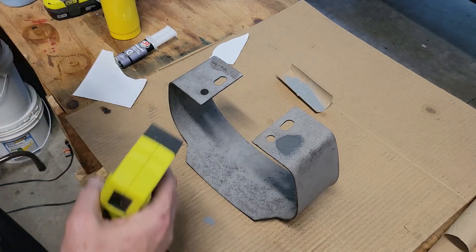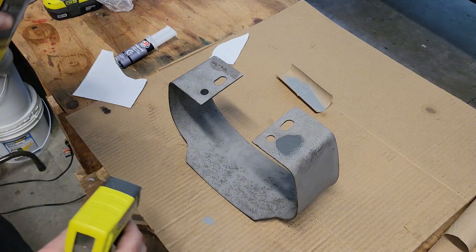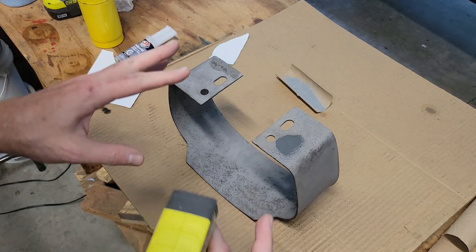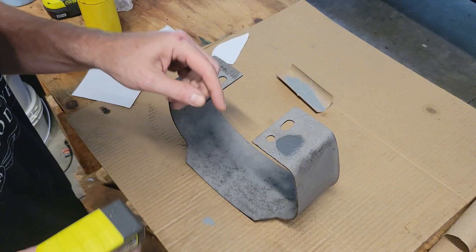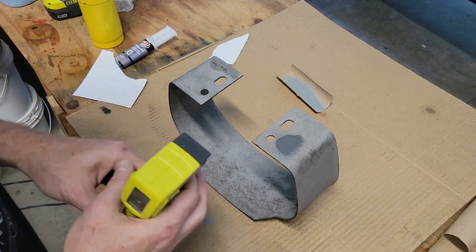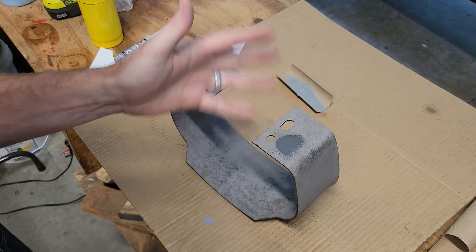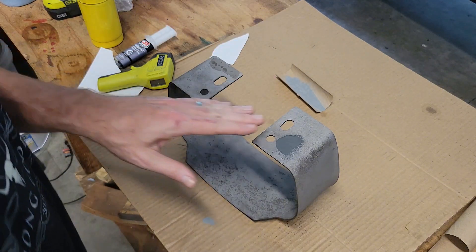So we're going to see. If I heat it from above it's just going to blow the powder everywhere. I could have heated the whole thing in the oven, brought it out, and tapped the powder on there — I actually tried that before, but once it hits the spot at 400 degrees it melts instantly, so I didn't feel like I had enough control. Anyway, I'm going to let that cure and dry, and see how well I can sand it down flat.